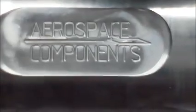Okay folks, we just concluded the test. We made a legitimate, honest 20 horsepower just by installing the belt, 16 inches of vacuum. It's an Aerospace Components 4-vane vacuum pump.